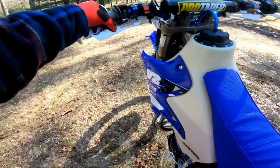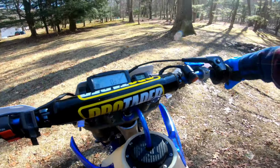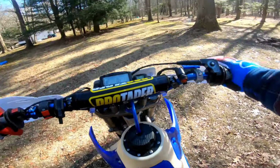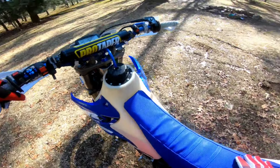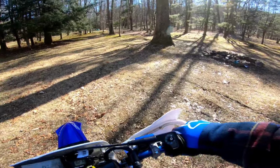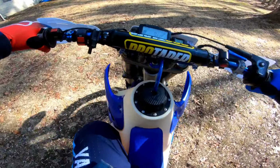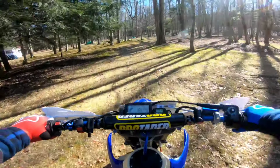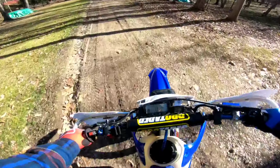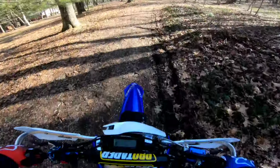I ran us around the alley a couple days ago. Seemed to give it a lot more low end, like everybody said. So we're gonna try it out. Test the air for a little bit. Up to about 101 degrees on the cooler. A little rich, jetted for winter. Good to go. Go easy here, break it in. Get her warmed up.